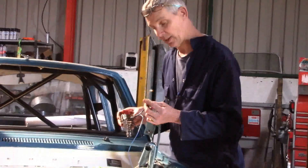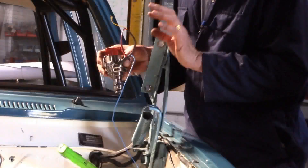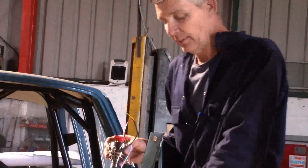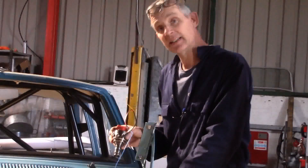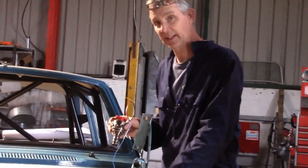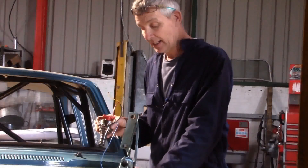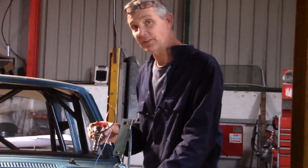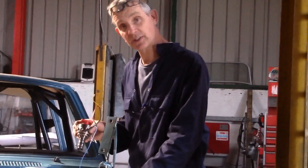The great thing about this distributor is that the yellow wire goes to a dash-mounted switch. You can select ground or 12 volts to select curve one or curve two on the fly. The most obvious use — and one that worked very well on the London to Cape Town rally — is that curve one, when grounded, is our full advanced curve expecting high-quality fuel. If you pick up poor quality fuel, as we did in Egypt, you switch to curve two by making the wire 12 volts. That curve is about five degrees retarded, and instead of pinking dreadfully you can use the engine hard again.